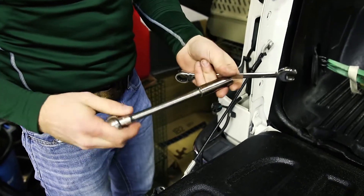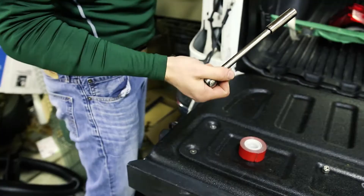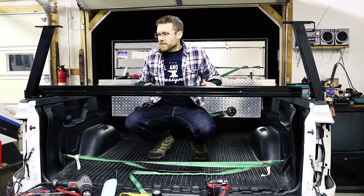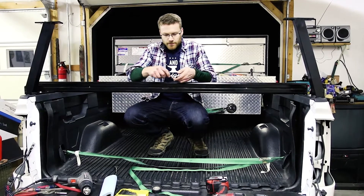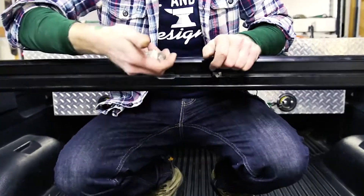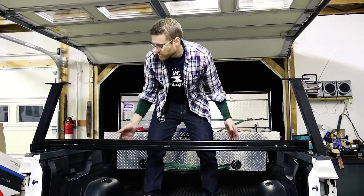Take a deep-well 14mm on a ratchet wrench, hold that bottom nut tight, and then tighten down the bolt on the top. Now take your tube extender — now that you have both side racks mounted — and using the four provided bolts, remove the nut and washer, slide it right in there, and line those bolts up with the two holes on each one of your side racks.